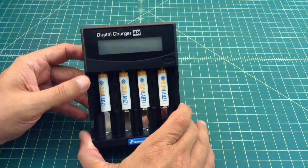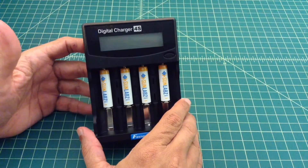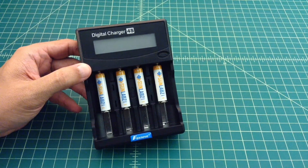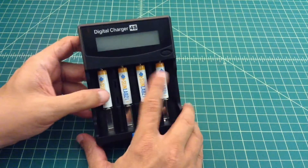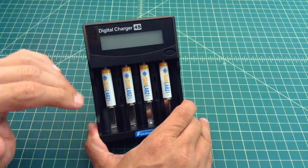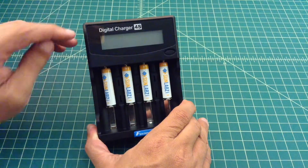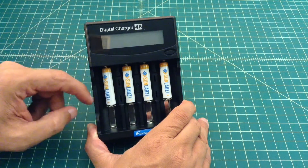The gist of this: I got 16 of these Sunlabs for $15.99. I did a test a while back on some Eneloop AAAs that I paid $14.99 for — one dollar less — but I only got eight of them. The Eneloops are rated at 800mAh; these are rated at 1000mAh. Right now three out of four are performing better than the Eneloops. I'm not saying these have as many charging cycles or that they're better batteries overall, but for things like TV remotes or window alarms there's plenty of use for a lower-cost alternative at almost half the price.